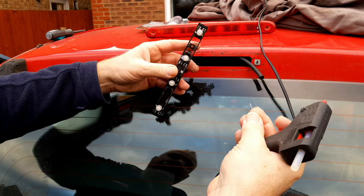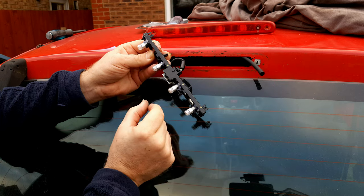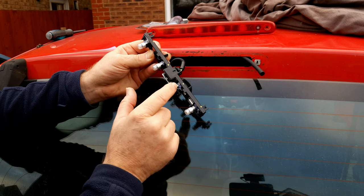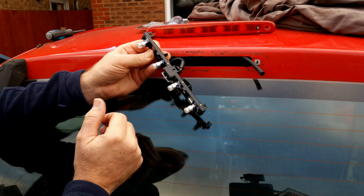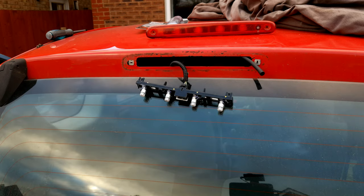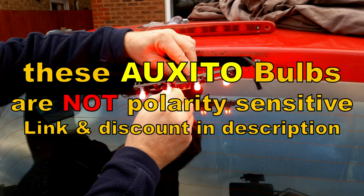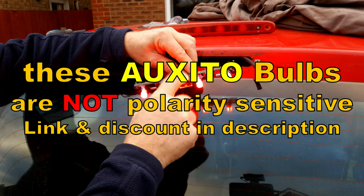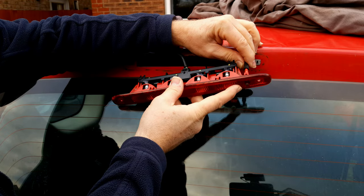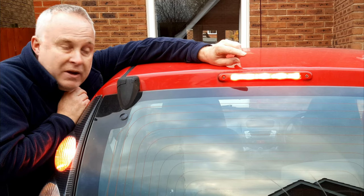Cut the strings off when they dry. A bit of silicone or hot melt will help stop the bulbs vibrating in their contacts over time and prevent poor contacts, but it's not so strong that you'd never be able to remove the bulbs should they fail — so don't use epoxy or super glue. Double check everything is working perfectly: all four bulbs come on, they're solid in position, no flickering. Then it's simply a matter of putting it back together the way it came apart.